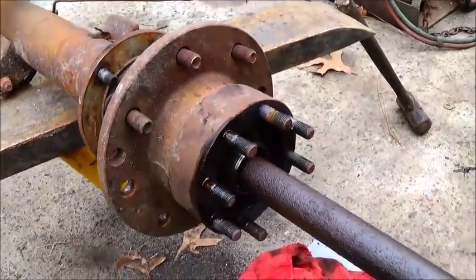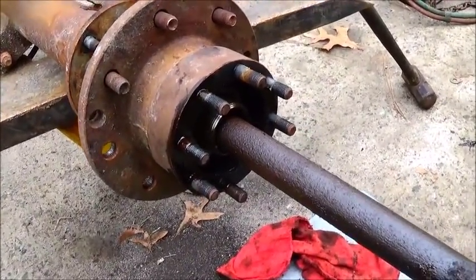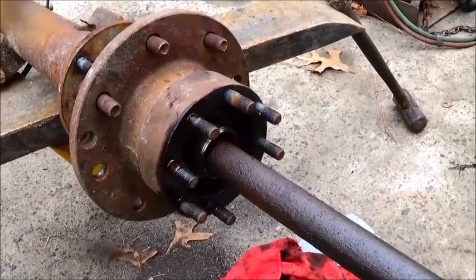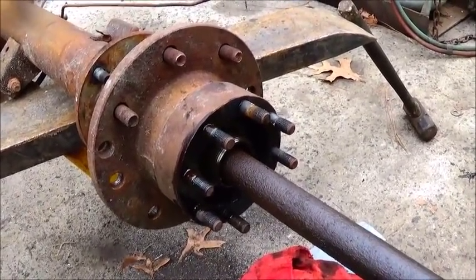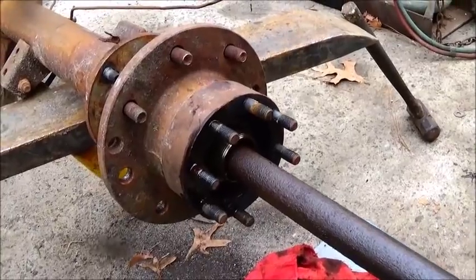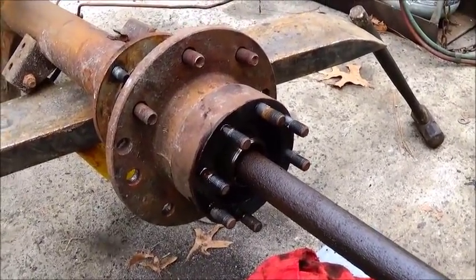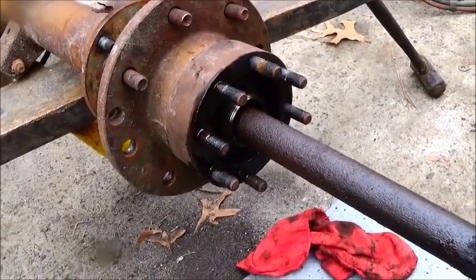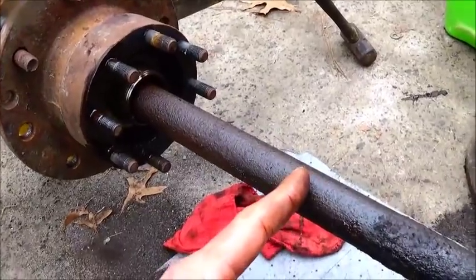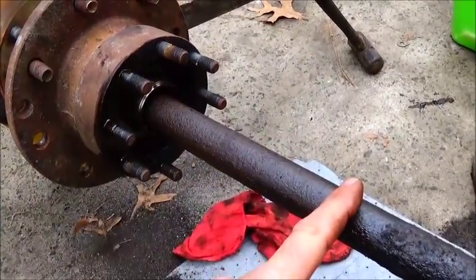But axle wise, the advantage over having a regular axle is that a regular axle you'll need to get cut and resplined, and then you have it heat treated. I could spline them here. I probably don't have the right cutter. I do have a dividing head and a horizontal mill where we could do the splines, but the heat treating we'd have to get done. But the plan is to cut the axle wherever we need to cut it, and on this end, leaving the splines on the other end.